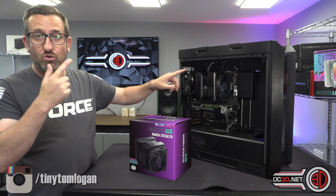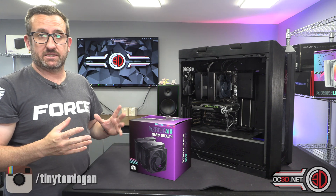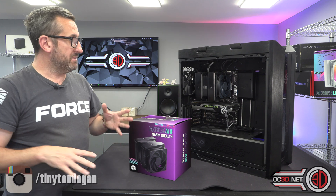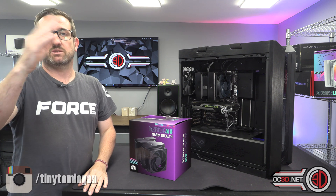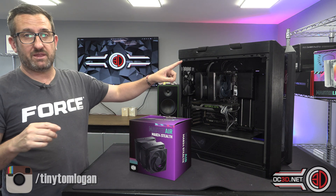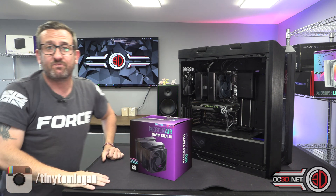I tried getting at the 140mm fan in the middle because I wanted to put one of the 120s in there so they'd match, but I gave up — I was going to have to take all the screws apart and the C-clips to dismantle everything. It's definitely not user-friendly. Neither is the mount, because if you've got a board with heat sinks on the MOSFETs around the socket, mounting it is an understatement of difficult. I ended up with the case on its side with my phone in there, literally having to locate the holes and put the screw in from the top. I hated it.